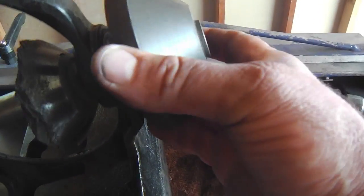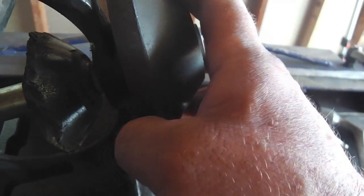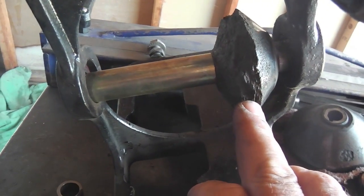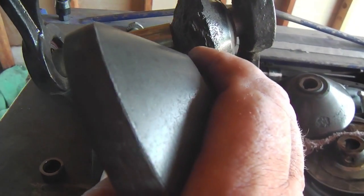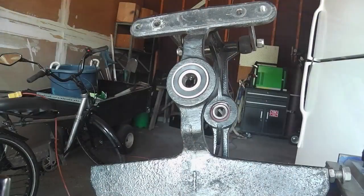So I'm going to put a little shim between these two. And actually, it's going to be on this side. This will sit up top, but for illustration purposes, you'll want to do that. You'll want to make sure that it doesn't impinge on the bearing. And so there, a little shim. I've got some. I'll show you when I do it. But on the inner one, it won't matter, because this side just butts up to the spacer. So no problem there. It's not against a bearing. Up top, there's space, so it's not going to impinge on the underside of anything down here.